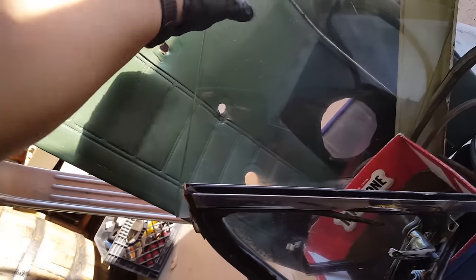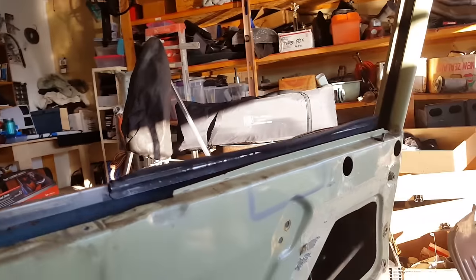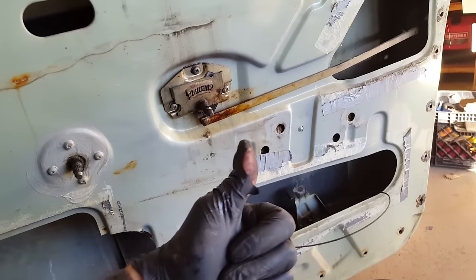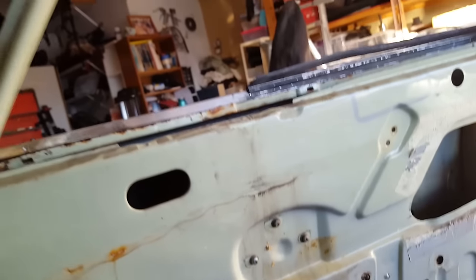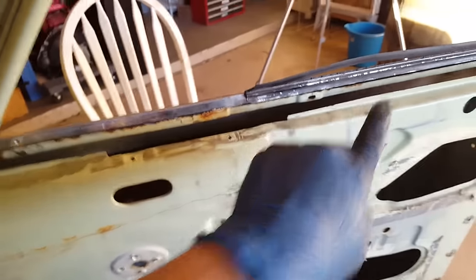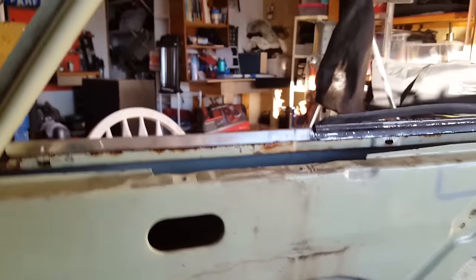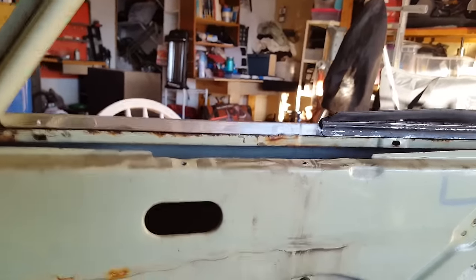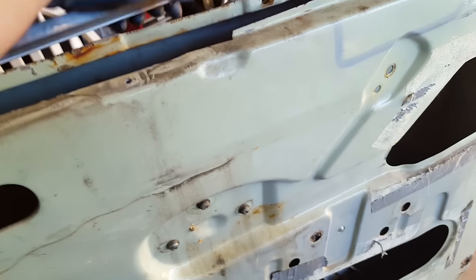This is the box of all our front parts. This trim piece was a pain to remove, and I'm going to see if I can tackle it a better way this time. We're removing these for sandblasting. Also quite a bit of butyl putty in the holes holding the big black handle. I figured it out — this trim piece, the really frustrating one, it just slides over and pops on from the back with little turtle clips, and it just comes out. I would have saved myself so much trouble.